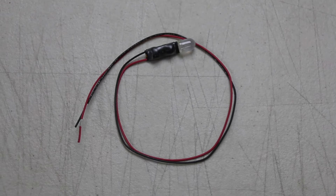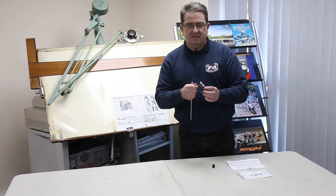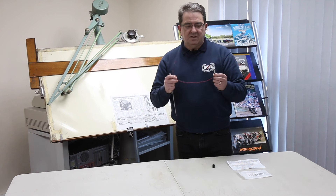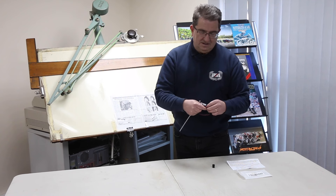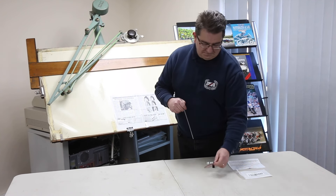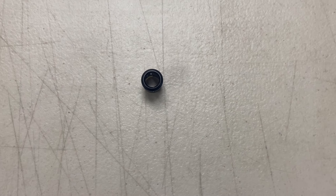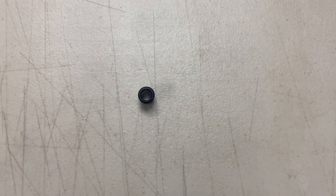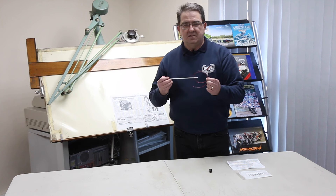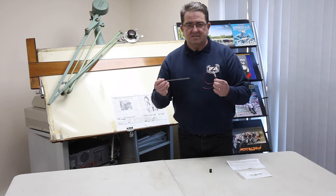That AC voltage then went to a bi-metallic strip to make the light go out in your headlamp shell. This doesn't do that — it sits across the battery voltage and tells you what the battery's doing. It doesn't tell you if your rotor's going round and round. It comes with an adapter bezel that you can fit into the headlamp shell. The beauty of this is it will give you changing colors in the LED depending on the voltage level that your battery is currently experiencing and being charged up.